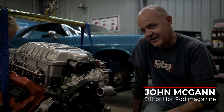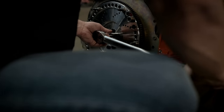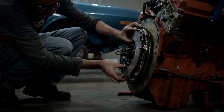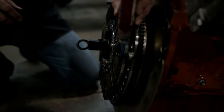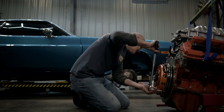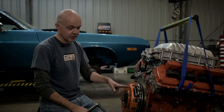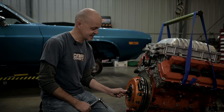I have the very important task of keeping the engine from rotating while Kevin tightens the flywheel bolt — any more and he might launch me across the room. It's a tedious process, but what I'm doing is tightening each one of these pressure plate bolts a little bit at a time and then checking the alignment tool to make sure each one of our components is still in place.